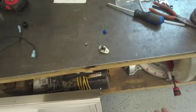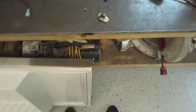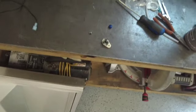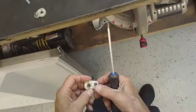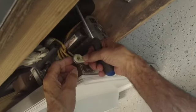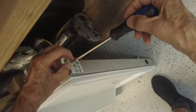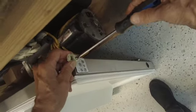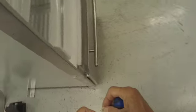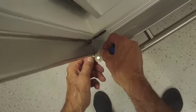Now I've already taken the door off. We'll show you how to put the door on — to take it off you just have to reverse the procedure. So put the new cam on. This is the upper cam that goes into the door — it's the one with the ridge around it. Put it in like that, screw the screw in, and then put the lower cam in.